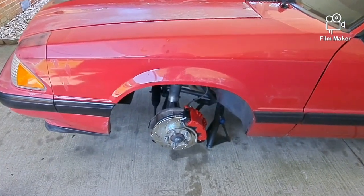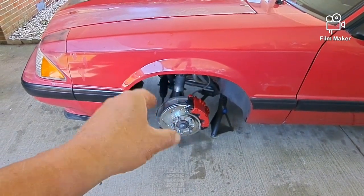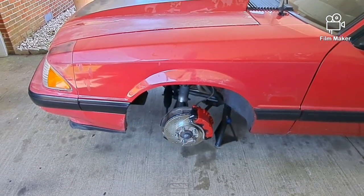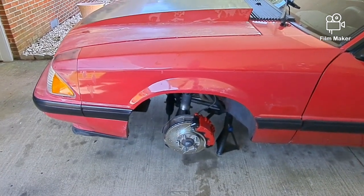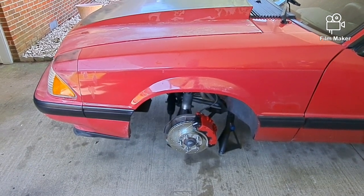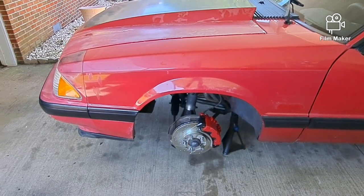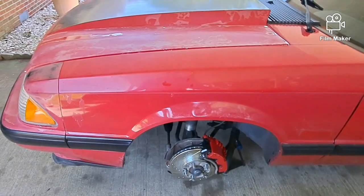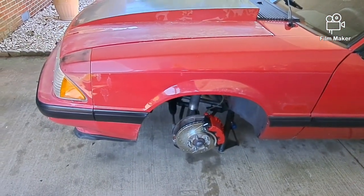I think with the aftermarket brakes, most of your weight savings is a smaller caliper and a thinner, smaller rotor. That rotor by itself is 12 pounds, and the caliper and bracket was 8. So I don't know what the Strange brakes weigh. I was thinking of getting some for the trooper car once I keep rubbing some nickels together. But these are staying on this car. I'm not getting all maniacal with the weight savings on here. So just wanted to add that in there.